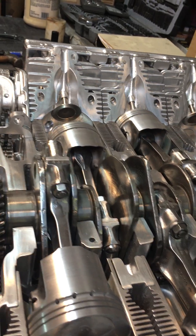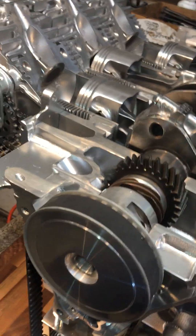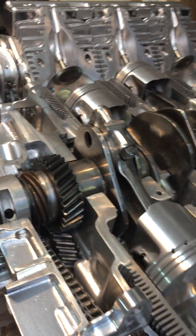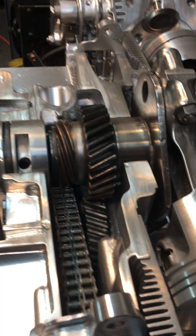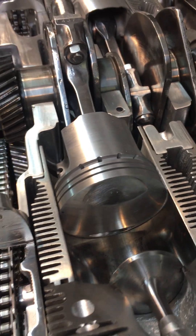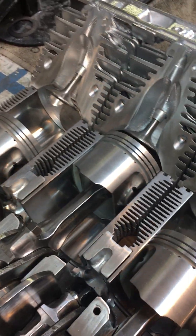I don't know the service interval on this because I've never run it long term — I might count on you guys to tell me when it needs oil. These are all basically journal bushings, metal on metal, except for the piston sleeves. I'm using a 20-thousandths UHMW — ultra high molecular weight polyethylene — sleeve, which is an amazing plastic that doesn't wear. Similar to nylon but practically indestructible. The idea is these run dry and will hopefully polish the inside of the cylinders. You don't really need to lubricate them, but silicone spray might be okay if needed.